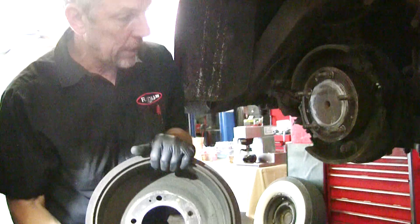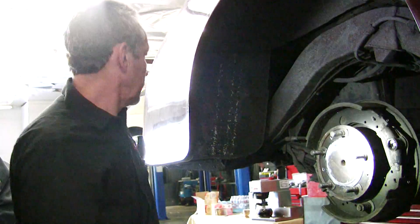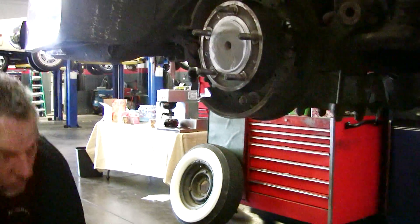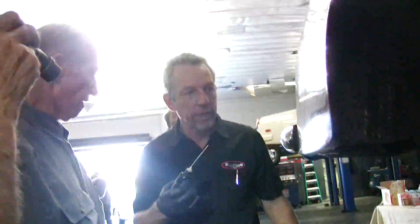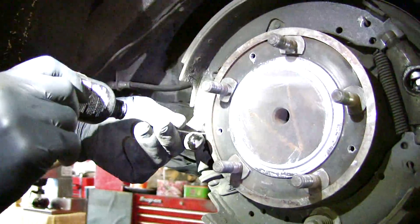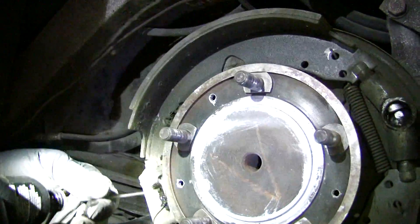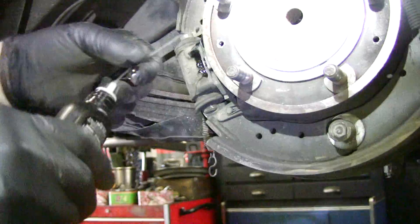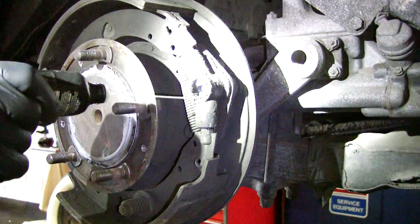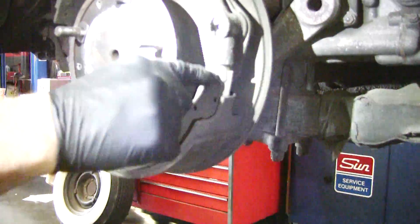As you can see, you get lots of dust in these things. Typically I'll take brake cleaner during the service, spray it off and spray this off. I'm going to dump this in a trash can. It's a good idea to lube it — a great idea. I'll show you what I use — it's called Tri-Flow bicycle lubricant. I just put a couple drops on there; you don't want to put a whole lot. You can even put a drop on these little pivots because it's all mechanical. You can even put a drop up here — I've seen where these freeze and don't release.